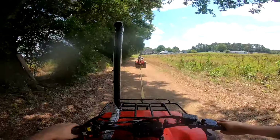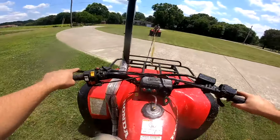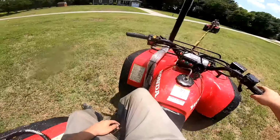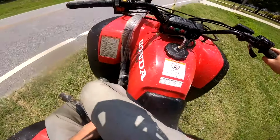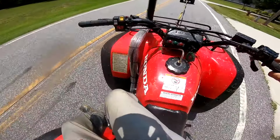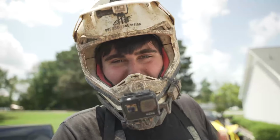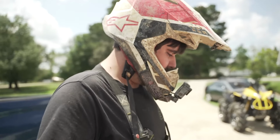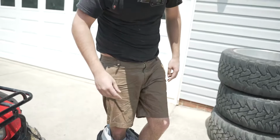Watch this. Jesus, Braden, chill out. Now we're gonna go change the oil and blow out all the vent lines. Hopefully we don't have to clean out the carburetor if any crap got in it through the vent lines, which it probably did because that thing is slam full of mud. I mean, I didn't dunk it for long. I was surprised it turned off. It should have stayed running. Go ahead, drain the water out of the exhaust, drain the water out of the airbox, and go in the garage and start this oil change process.